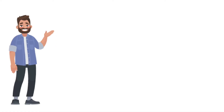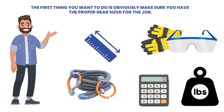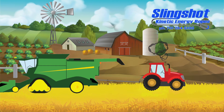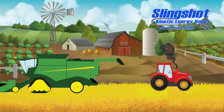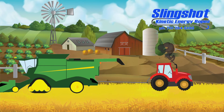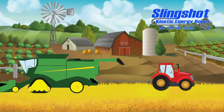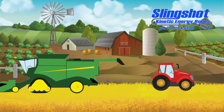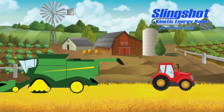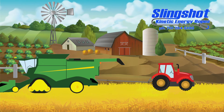Here's the proper way to use our recovery gear. First, make sure you have the proper gear sized for the job. Once you have everything hooked up tight, you'll want to do a static pull — meaning pull the rope tight and try to remove the disabled vehicle without any running start. If this does not work, back up four feet and try a slight running pull. Once you feel the rope tighten up and the pulling vehicle starts to slow down, stop accelerating and hold your brakes.